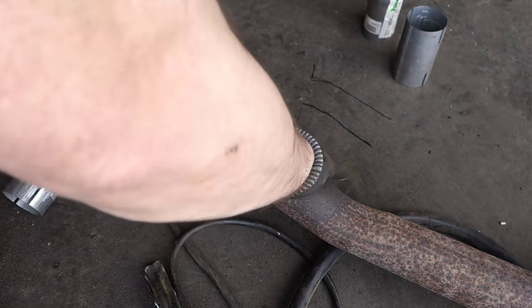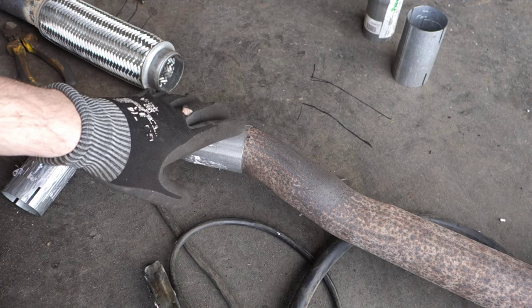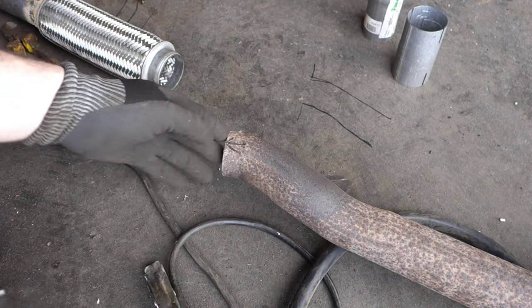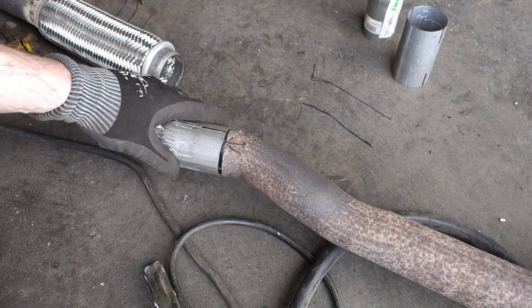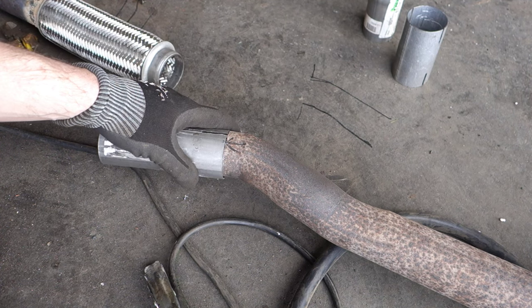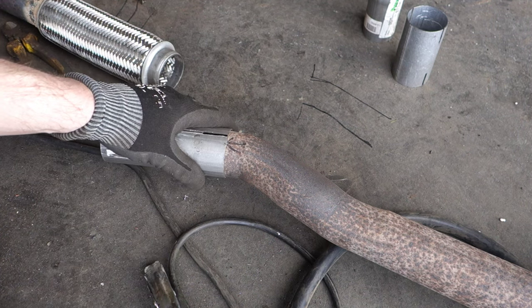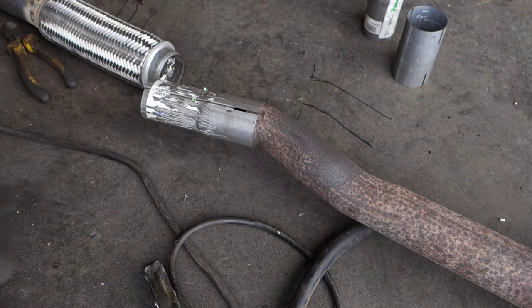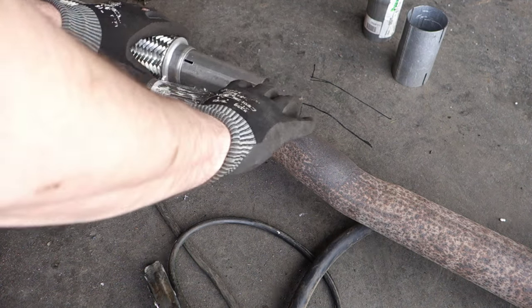And now I am planning that I will install that in this way, and when we make exhaust pipe joints ourselves, it is extremely important that we do not insert these pipes end to end. That means that two pipes are together, no this kind of joints. This is a bad joint if we do welding, but this is good when I add that in here a little bit, like 1/2 inches. This will be last, and then I have that pipe which fits in here, and it goes in there,